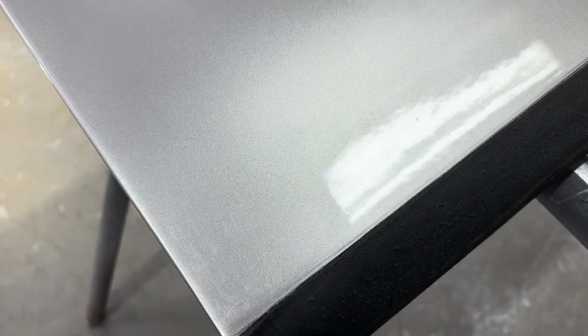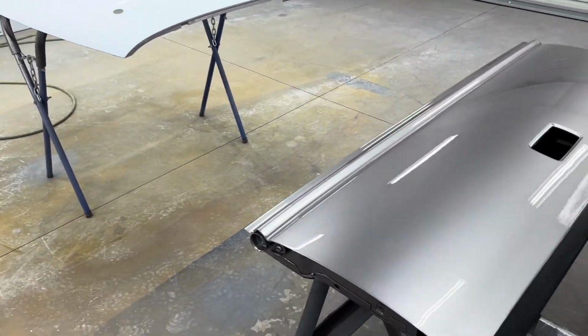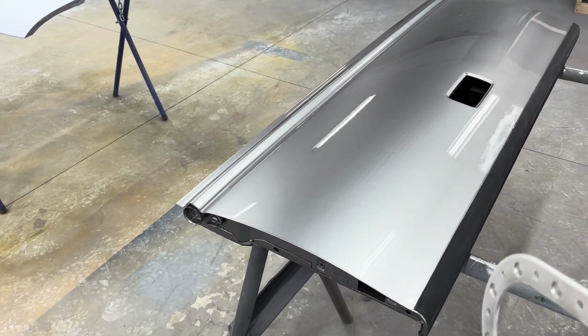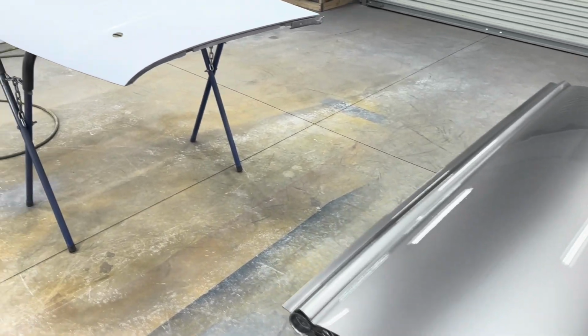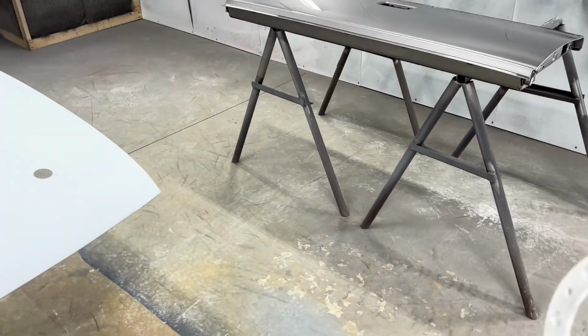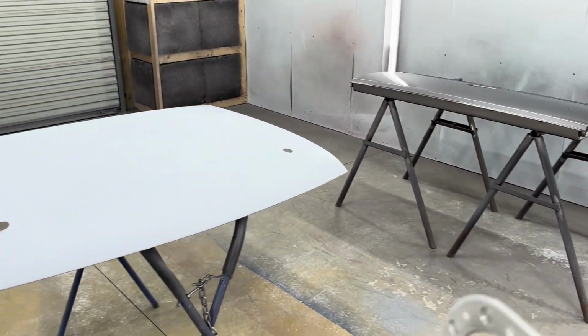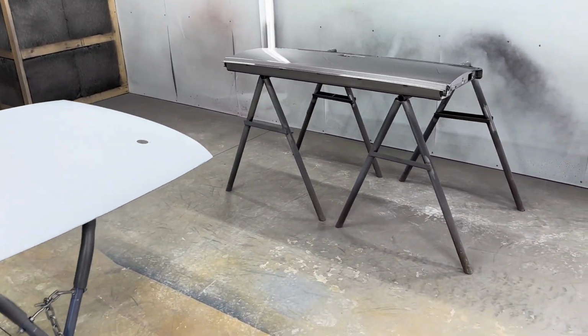I don't like finish sanding with 320. That's why I do 400, because I've seen that before. And that's one reason why I go over it with 600, is because I don't want to even see that showing 400 scratches, which I don't think it will, especially if I have a heavy bodied sealer over this. It probably wouldn't have done anything.